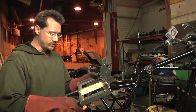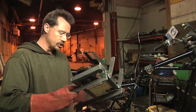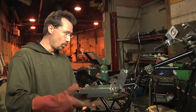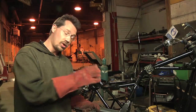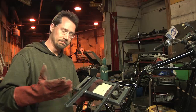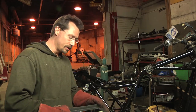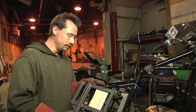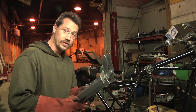Here it is — the basics of the battery rack for the motorcycle. It's got four connection points so the whole thing can bolt and unbolt from the frame, which will make it a lot easier when I have to install the motor and do other work. The welds — some of them could look better. I'm just a beginner welder, so I'm probably going to take an angle grinder to some of these, grind them down a bit, make them look nicer before this gets painted up, but for now it's going into the bike.